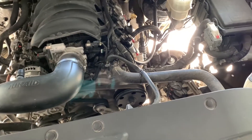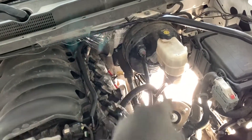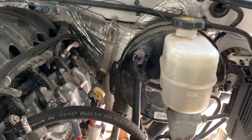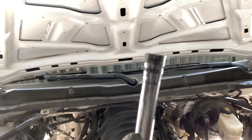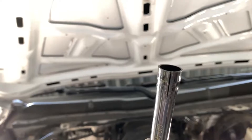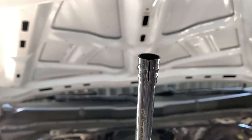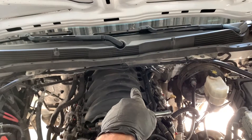The first thing you're gonna do is remove the vacuum line that goes from the vacuum pump all the way to the booster. One side goes to the vacuum sensor and the other one goes to the vacuum pump. We're gonna take the vacuum sensor from that line. It's really easy — you just take a knife, warm it up until it's red hot, and then ever so slightly cut it alongside like this, and that should liberate the fittings. The fittings are going to be 3/8 so they are the perfect size for you to reuse the PCV fitting that you previously deleted.